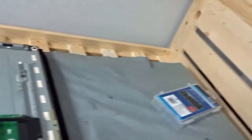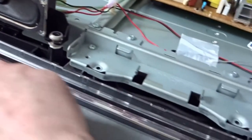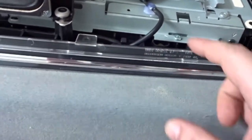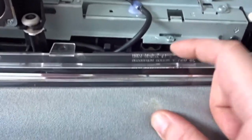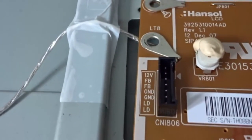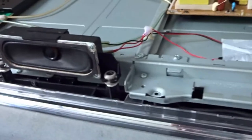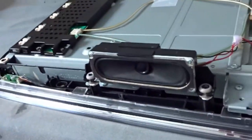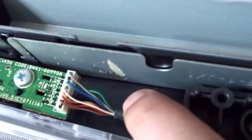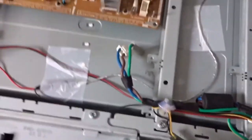It's a bit like the same principle as Dolby Atmos — the sound will come out the top of the set. There's a great big vent right the way along the top of the back, so it's going to be absolutely ideal for that. On the front of the set there is a clear plastic trim that goes all the way along. I've had the idea that it unclips and there's enough room behind there to fit an LED strip, using the 12-volt supply on the board at pin number one. In theory, that could fit a remote control LED strip to give the television some ambient lighting at the front — I could change the colours with the remote. That's a project for another day.